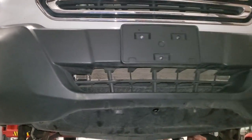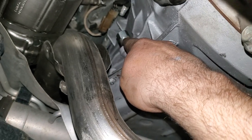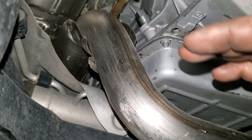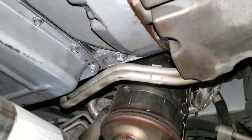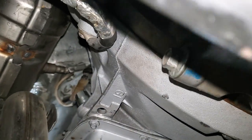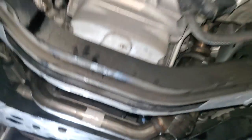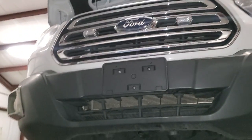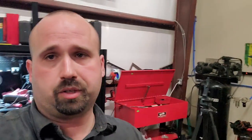After all that, start it up — you want to get it to 200 degrees and check your fluid level. Remove the dipstick, clean it off real good, and at 200 degrees you want to be somewhere in the upper range. You want it hot enough because you had to purge the cooler — hot fluid running through it will make your fluid level drop a little, but Ford sends their transmissions with a good amount of fluid. Don't forget to plug in your O2 sensor on the back of the valve cover. Top off the power steering fluid and you're good to go. I hope that was helpful — doing just a transmission remove-and-replace video on this one. If you liked it, like, comment, and subscribe, and we'll see you guys on the next one.